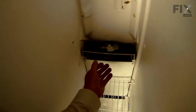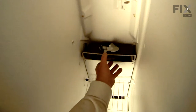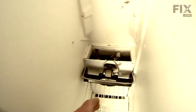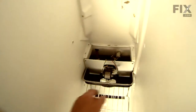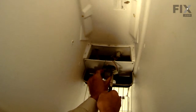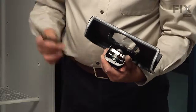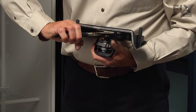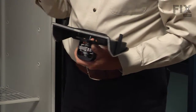At this point we'll be able to access the evaporator fan motor. It sits in a little mounting bracket that you can lift out of the way. If the blade won't pull easily off of that shaft, we can simply remove the wire harness connected to the motor. Using our needle nose pliers, we'll pull the ground wire off and then carefully disconnect the two wire harness on the opposite side. Then we can pull the whole assembly out and remove that fan blade by reaching in between the fan blade and the housing and prying gently up on the blade until it pops off. We can discard the old one.